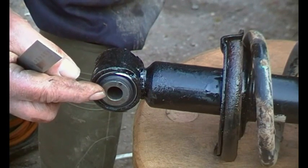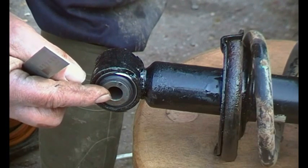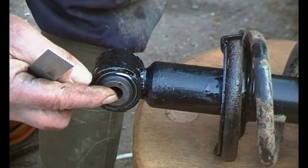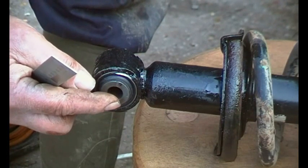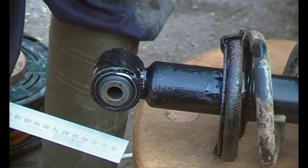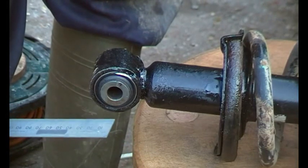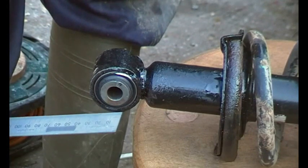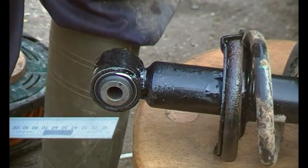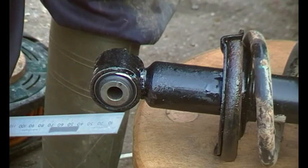So word of advice to anybody who's got a Mark II or even a Mark III is just undo these nuts. Undo the bolt. If you can get underneath there, just undo it, make sure it moves, and then sort of oil everything up. And of course that goes along with the advice of spray the bottom of your car once or twice through the year with some oil. Get it to soak into all the threads. It hadn't done any good on the passenger side of my vehicle, but I've only had it a couple of years. But it's been sprayed about 4 times, and you can see where the build-up of oily sort of layer is really starting to help.